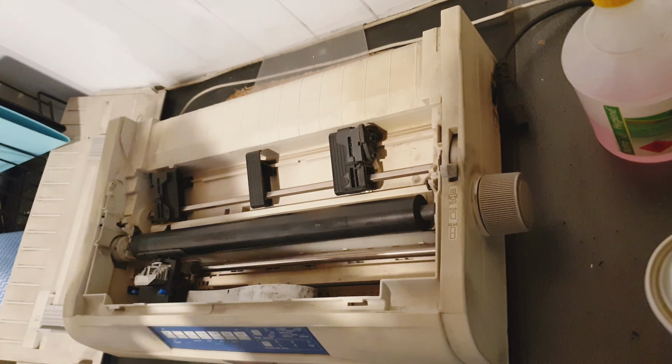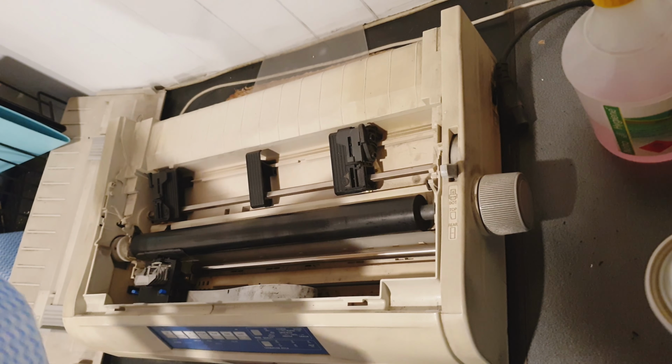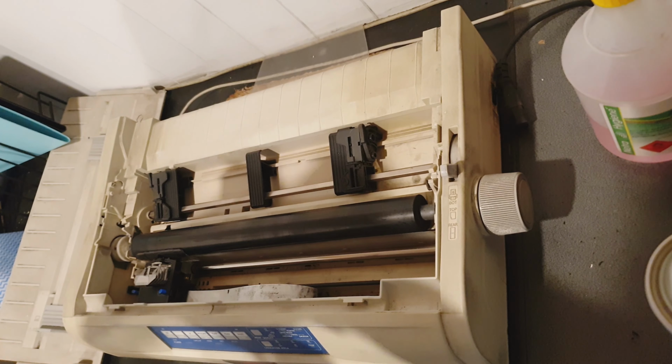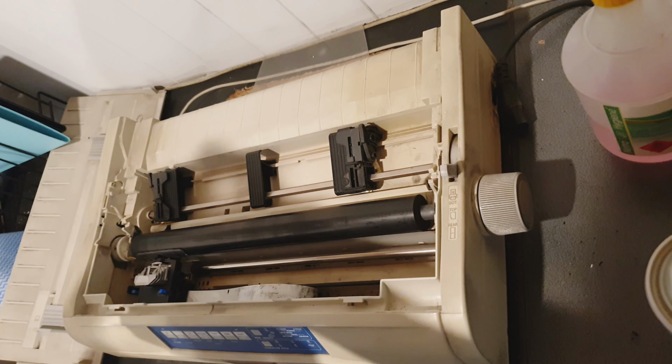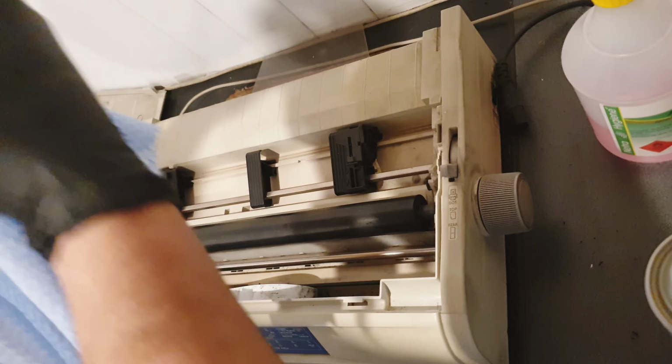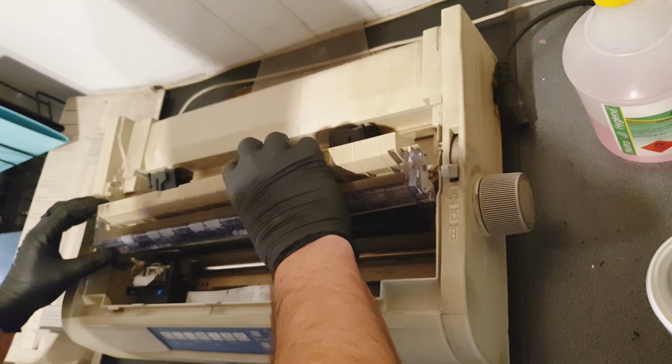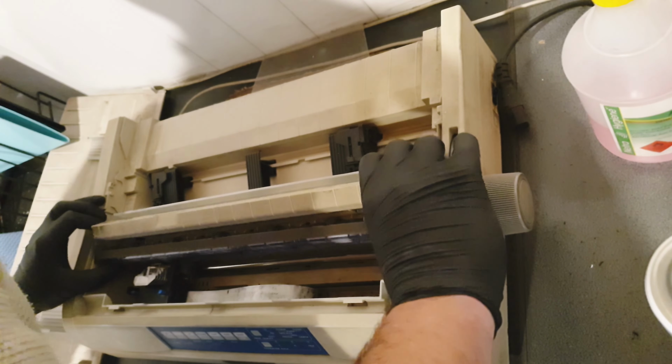But avoid buying that printer head because it is pricey. So try the DPI settings by increasing it. Otherwise, clean it all out, make sure the connections are good, and plug it back in. Replace the ribbon, and then put the whole thing back together again, and you should be happy.